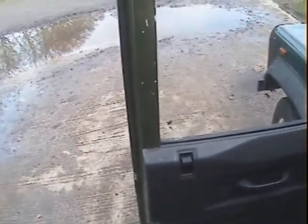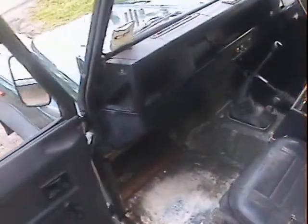The frame on this one is poor — electrolytic reaction down the bottom edge and delamination. The near side door frame has gone right along the bottom edge, starting to go up along the edge near the hinge as well. It really isn't brilliant. It still shuts fine if you lift it, but it probably could do with a bit of replacement.